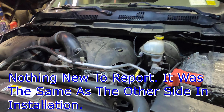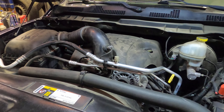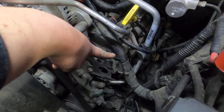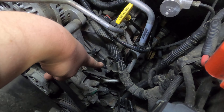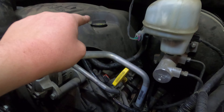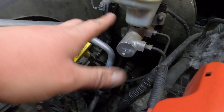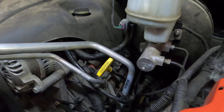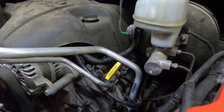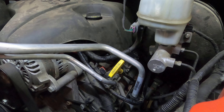And that's it - that's all 16 spark plugs, two for each cylinder, done. I ended up just putting all the stuff back pretty much the same way I took it off. There's a sensor, and the only real thing was this hose right here - I popped off a connector, put it to this side. There's one hose over there - I just put it on top and over the oil filler cap. That middle one you might have to snake your arm underneath, but I didn't disconnect anything - you can get everything via your hands. The only thing really left to do right now is start it and make sure my work is correct. I did each spark plug, made sure they're tight, clipped every clip until it clicks, and gapped all of them to 40 like the computer said.